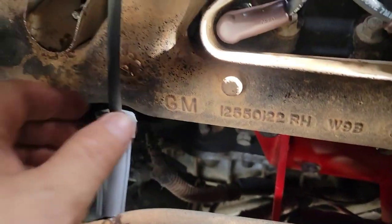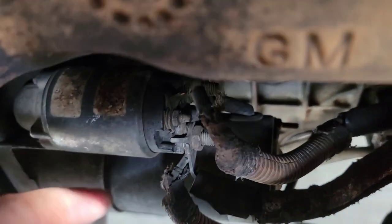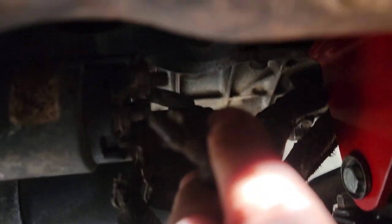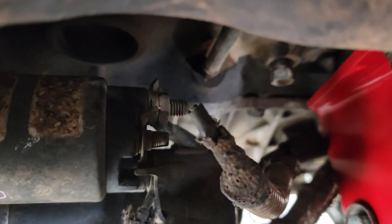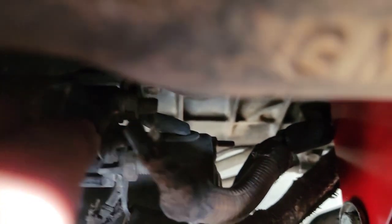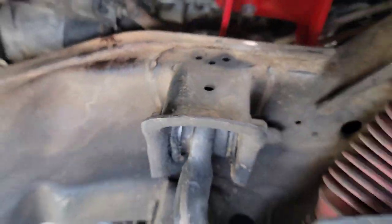I'm having a tough time getting this rear plug wire to seat. While I was working on that, I noticed the starter connector was weak — it was all bent over and I lifted it up and it snapped right off. So I've got to put a new wire connector lead on this wire. And that weakness there — it was bent over and touching the top of the screw. I don't know if that caused anything but that might have been part of my problem. Also this whole thing is kind of loose. I do have a new starter I could put in. Showing it because it can happen to you too.